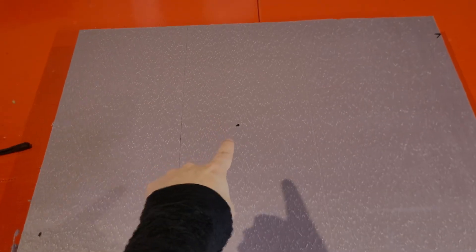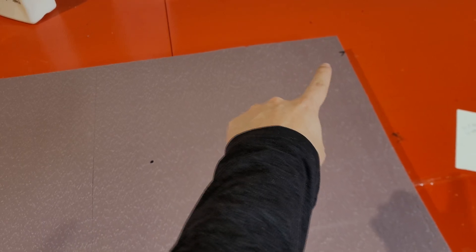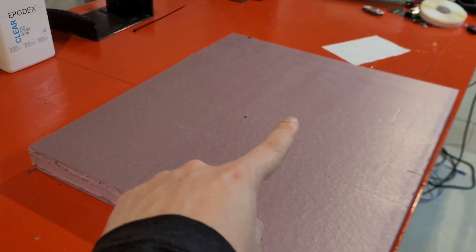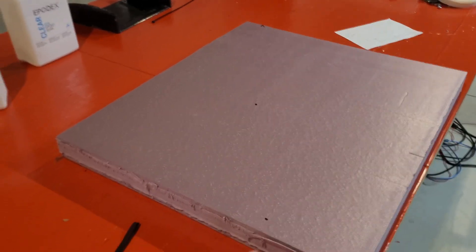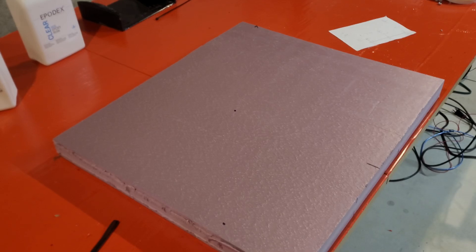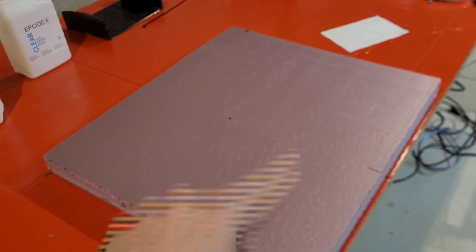Here, I'll just show you. So this is our six inch mark which should be right on this edge. That's our 13 and 11 and a half over from this edge, and then that's our 21 and 26 inches because it's 26 inches from there to there. I was expecting this dot to be kind of down here so it would have a natural slope, because curved diffusers typically work better than single plane diffusers. That just means we have extra clearance I wasn't really expecting, so I can basically freehand an arc from this point to that point.